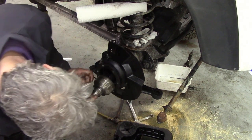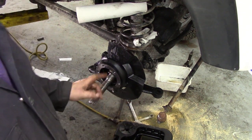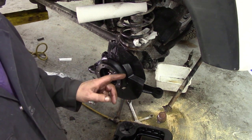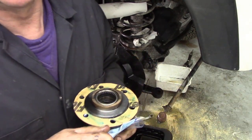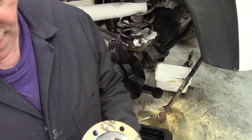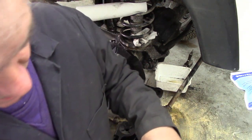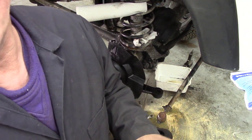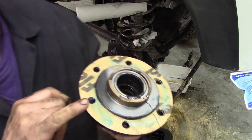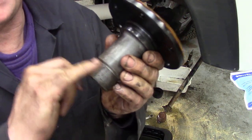There we are - tricky, but that's in. Next thing: on this flange I'm going to put a little bit of Hylomar on the gasket, and I'm going to clean up the bolts and again loctite - same rules apply. Don't put it in dry. On this needle roller bearing here, give it a head start with some grease - some of the CV grease. It'll thank you for it later. And on that oil seal - I know it was a bit of a cop-out not changing the seal, but it meant changing the bearing and I think this seal's all right, it's still flexible. I only put the finest smears of blue Hylomar on there, and when I put them on I like to put the flats to the top.